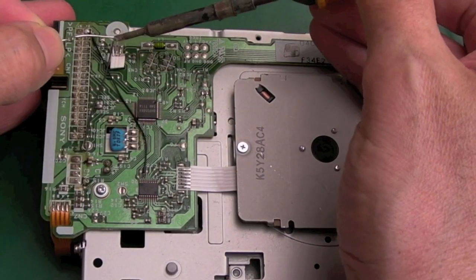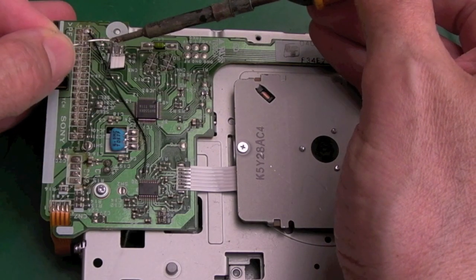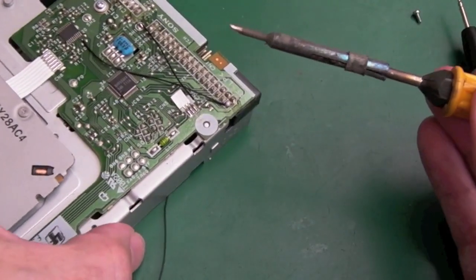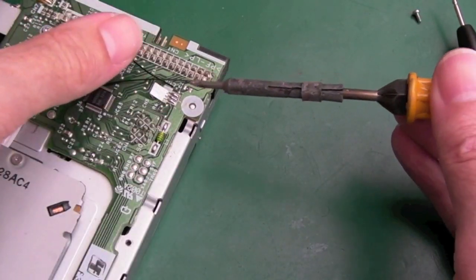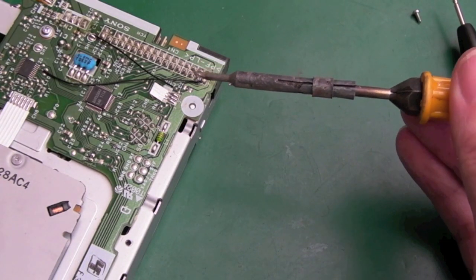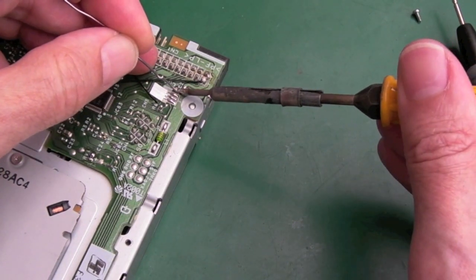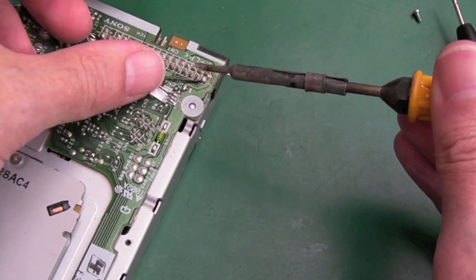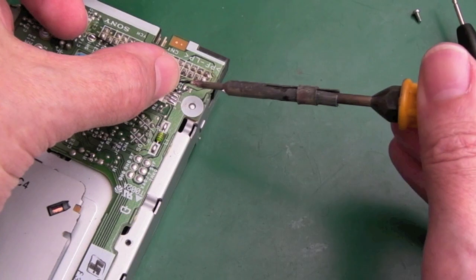So I guess the other nice thing with this is it's super easy to revert. You could even add your own little jumpers for these wires actually, if you wanted to toggle between an ST and an Amiga. And in fact, you used to be able to buy drives that were kind of modular. CPC and Preston, who I've mentioned a number of times, used to, when I was back in the trade, sell, I think there were certain Chinon and TEAC drives that you could get that had a series of jumpers, and you could configure them to work as an ST drive or an Amiga drive.